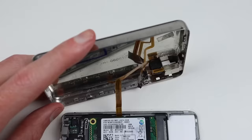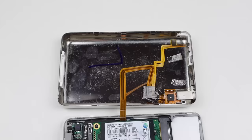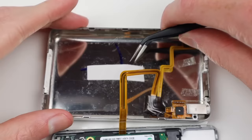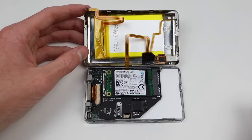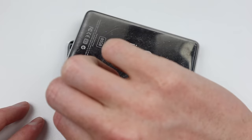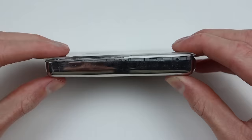I needed to figure out how to position the battery higher up in the iPod. Removing the battery and adhesive securing it, I then removed a foam piece near the headphone jack. With that foam piece gone, the battery sits higher in the device, leaving room at the bottom for the 30-pin dock connector. I applied a fresh piece of adhesive to keep the battery from rattling around, pressed it up as far as I could, and seated it into place. From looking at the cell it appears to be made by LG, though I can't confirm that.